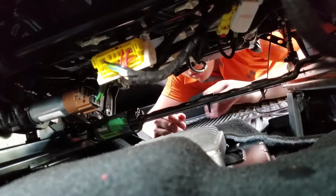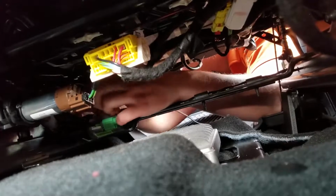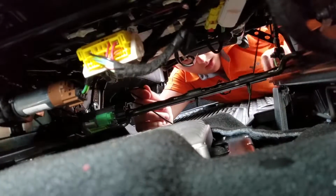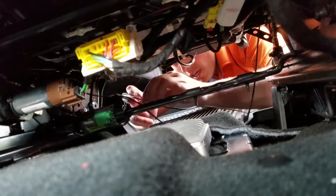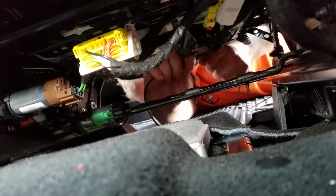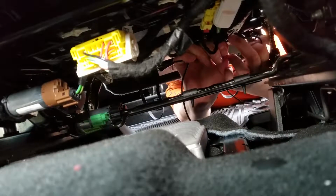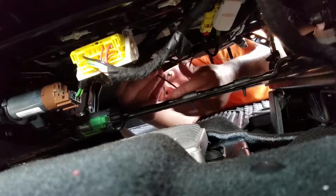Now that I've pulled them tight to help the cover take to the shape of the seat, I'm going to tie just a simple loop in the one that's closest to the center console. Just like that. And now I'm going to take the other string and run it through that loop and tie it back on itself. That allows you to get a lot of tension on that string, and that's what keeps the cover from sliding around. So the tighter you can pull that, the better. And then I'll just tie that back on itself in a knot that won't slip. Just like that. Now we'll just tuck these up out of the way and finish putting the cover on.